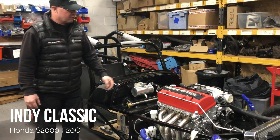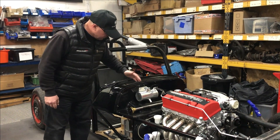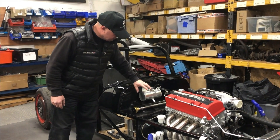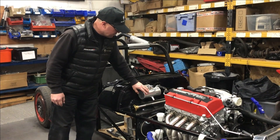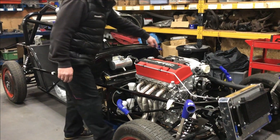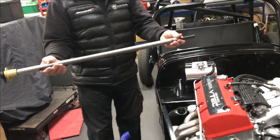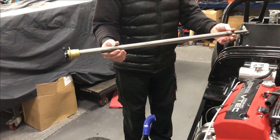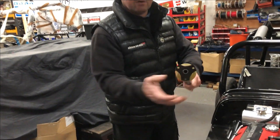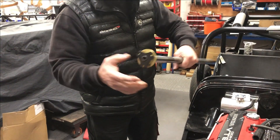Just running through the S2000 build on the Indy Classic that we've gone through this week — a few little changes. Obvious ones: the bulkhead panels have been put in, drilled and riv-nutted ready to go. The header tank OBP is in there, all plumbed in as well; we've got the last plumbing to do down to the bottom hose. Also made this week is our one-piece top column — the bottom column is collapsible on this as well — and we've got a nice quick-release Racetech boss on there for the steering wheel.